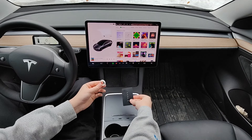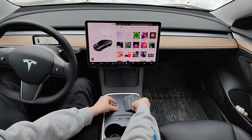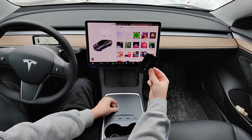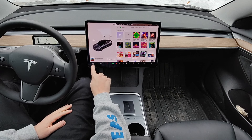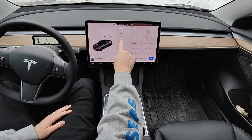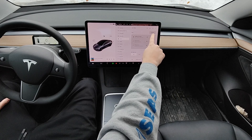To pair your key ring with your car, you'll need your key ring and your Tesla key card that is already paired and working. From the infotainment screen, click on the little image of the car in the bottom left-hand corner. This opens up the controls menu. Go down and click where it says Locks, and in Locks, click on where it says Add Key.